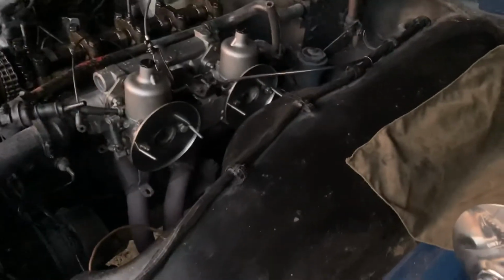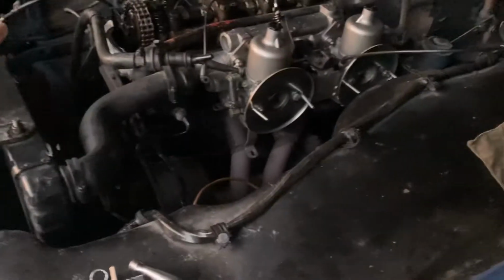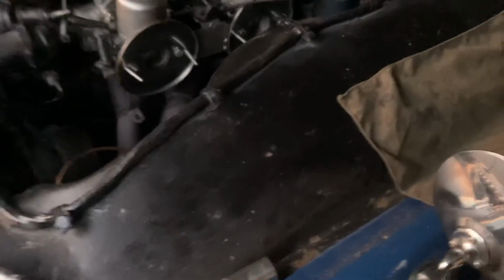So after I peeled back some of the filler fiberglass, I noticed a little bit of rust. I started scraping away some of the paint. Then I noticed, oh, that's quite surfacey. Then I started to have a little go of it with a screwdriver, and then went, oh. Thankfully, you can basically just cut this channel out. I will replace the whole thing. There's no point going to there when all this here is so close to blowing out because it's old and crap. So replace this channel here and there.